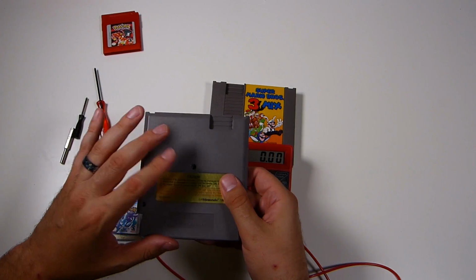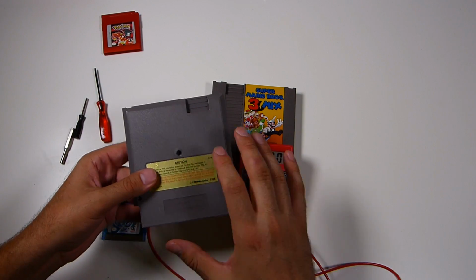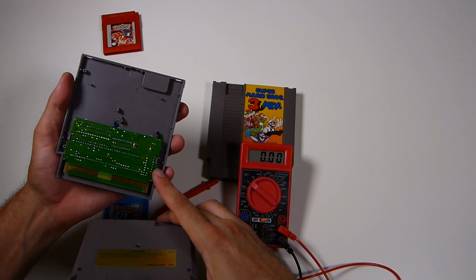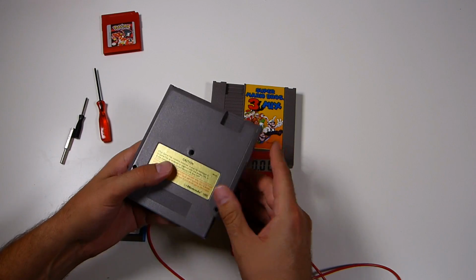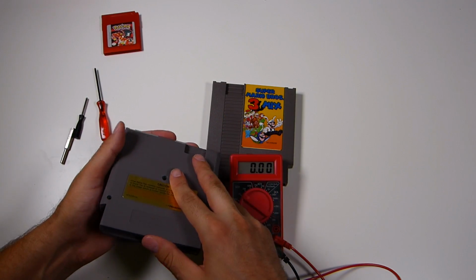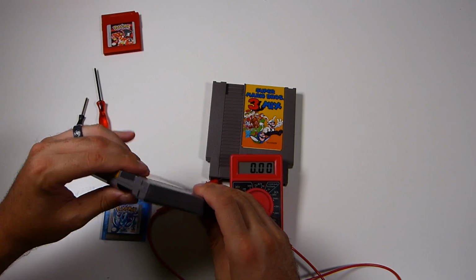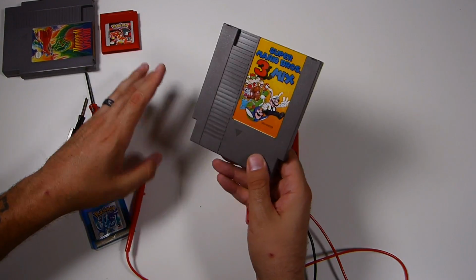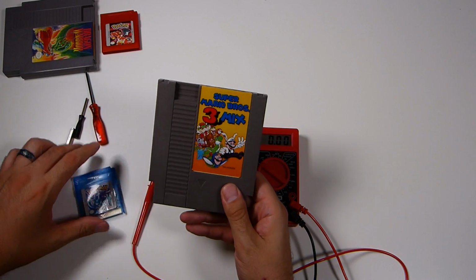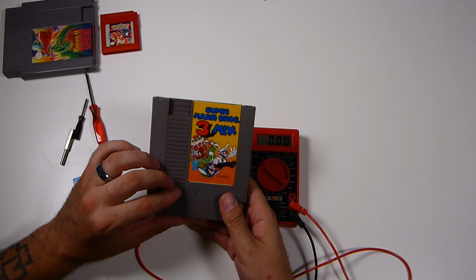And like I'm pointing out here with the original games, even the homebrews and stuff, make sure when you're putting the case back together, you don't have the screws still in the case, because you risk messing up the screw posts. So always make sure when you're clamping these back together, you put the screws in after the fact, because sometimes people will put them in and then kind of place it on top. You could bend the post, so you don't want to do that.